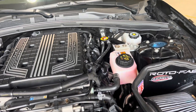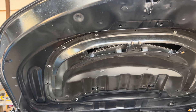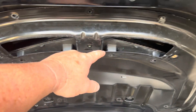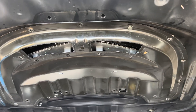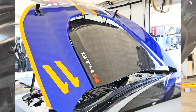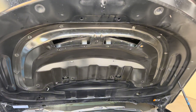We just got finished installing the supercharger reservoir, and now I'm looking at what I can do to move more air out from underneath the hood. What I recognized is, when you first get this car, they have this little rain deflector here — a little block-off panel to let rain not drip down into the engine. That's not really a consideration of mine. What I did notice is on the GT4.R Camaro, the Pratt & Miller car, is that they don't run this, but they do have to run the stock aluminum hood and the stock scoop. When I remove this, let's take a look at how much airflow that's actually blocking.